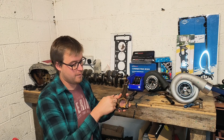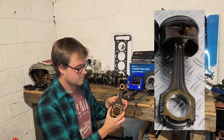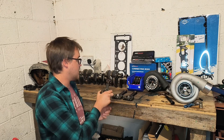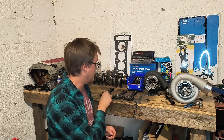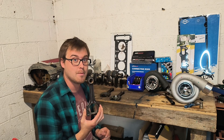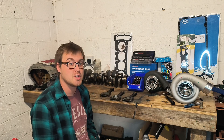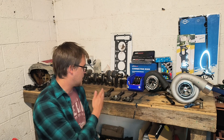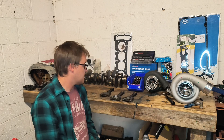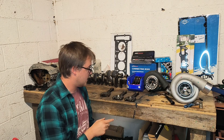This is a 149mm center-to-center rod. You'll see these rods here: this one is from an M102, and this connecting rod is from an M103 — though in actual fact they're both stamped M102. The M103 engine used M102 connecting rods. Similarly, the M104 2.8 and the M111 share the same 149mm connecting rods. The main differences are the length, but there are many subtle differences beyond that.